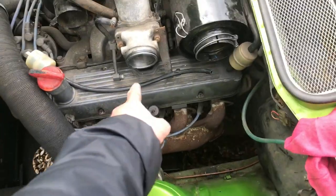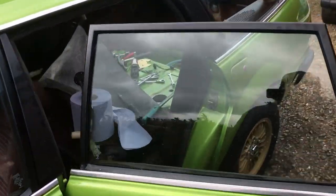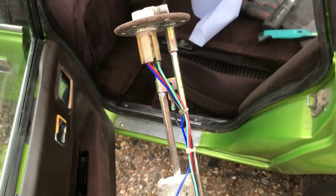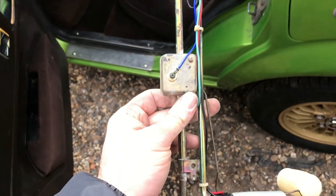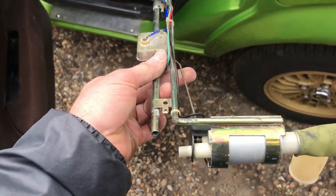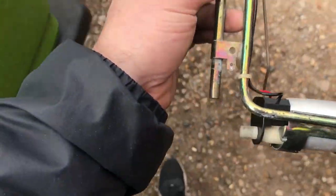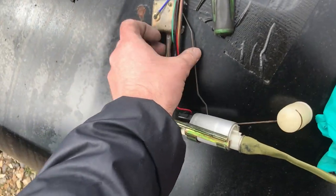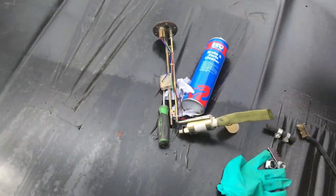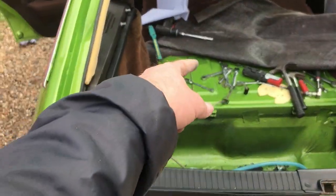What we are doing is cleaning and replacing the fuel filter. I'm going to try and clean that tank again. When I took it all apart there was loads of crap from the old sealer that had dropped in — I'd used butyl sealant, which had gone crusty and then dropped into the tank, which is part of the problem. I'm also replacing the little elbow with another piece of new fuel hose, because the stuff I used last time didn't like being constantly immersed in fuel and had gone a bit baggy. I'm going to clean it all up, put it all back together, and make a new little gasket for the tank as well.